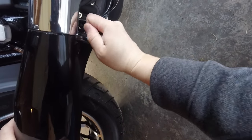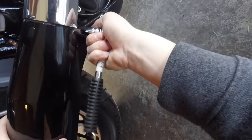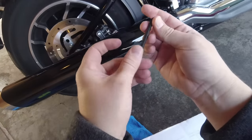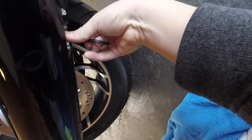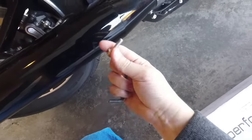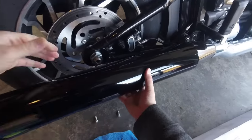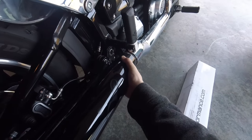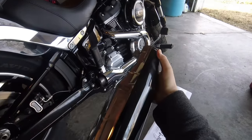I did loosen all this stuff already, because it was a pretty big pain in the butt — you have to put a lot of force, especially into this clamp here. I'm going to take my 3/16ths Allen key, or you can use a ratchet. We're going to reuse this hardware too, so don't lose it. We're just going to hold on to the muffler and the heat shield and wiggle it — and there we go. Pretty easy. It wiggled right off.